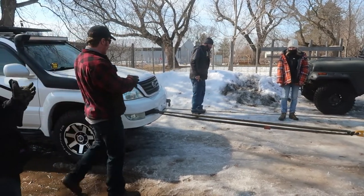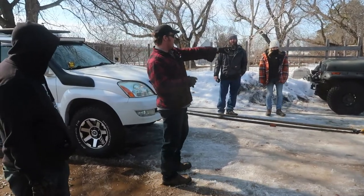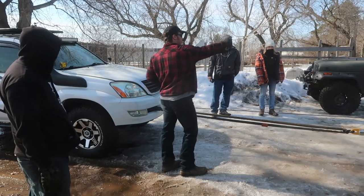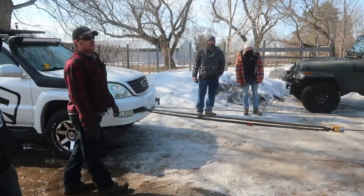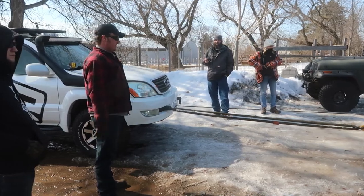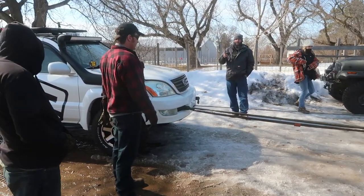For instance, if you were doing a direction change and you were using a snatch block over there and you were pulling that same vehicle, but now you're pulling it that way, you get a guy standing right here in the middle, if that gives way, he's getting taken out. Yep. So for this, all intents and purposes, everybody's safe to stand there. You can go ahead and put it in neutral and...